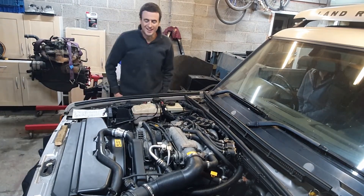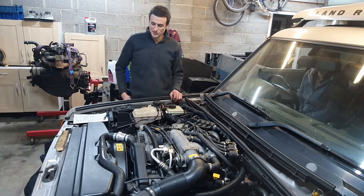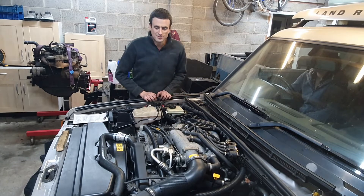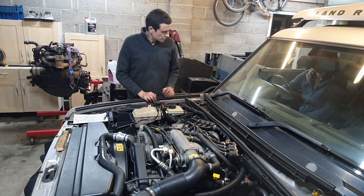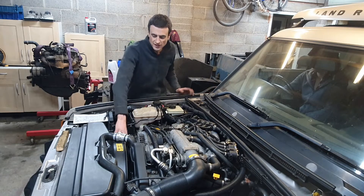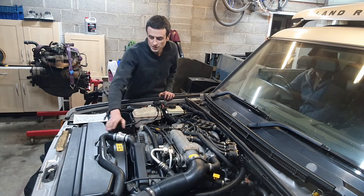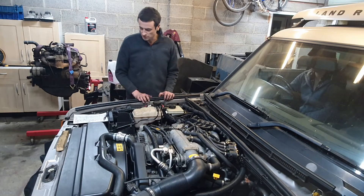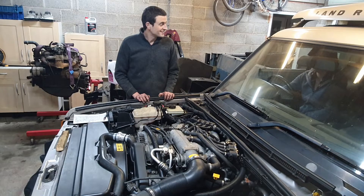All right, I've delayed as long as I can — we've got to start this engine. Mrs. Loz is in the car; she's going to turn the key and tell me when I'm around about two and a half thousand revs. My good friend Tom has told me to leave it there for some time. I'm going to watch on the OBD reader the temperature of the engine, make sure it stabilizes. There's a viscous fan — it should stay at a sensible temperature, I think. Check the new thermostat's working. I've got an infrared thermometer, I can check a few other bits and pieces. I don't think we can delay any longer — let's start it up.